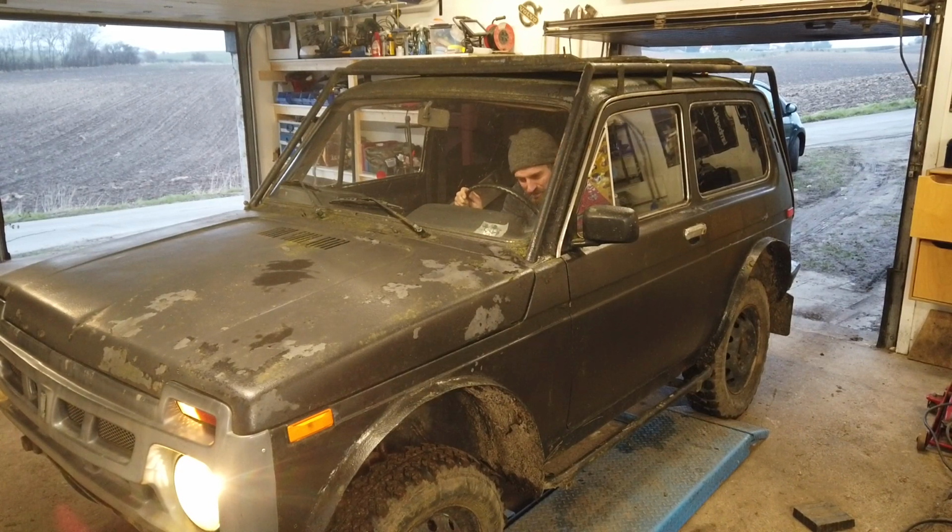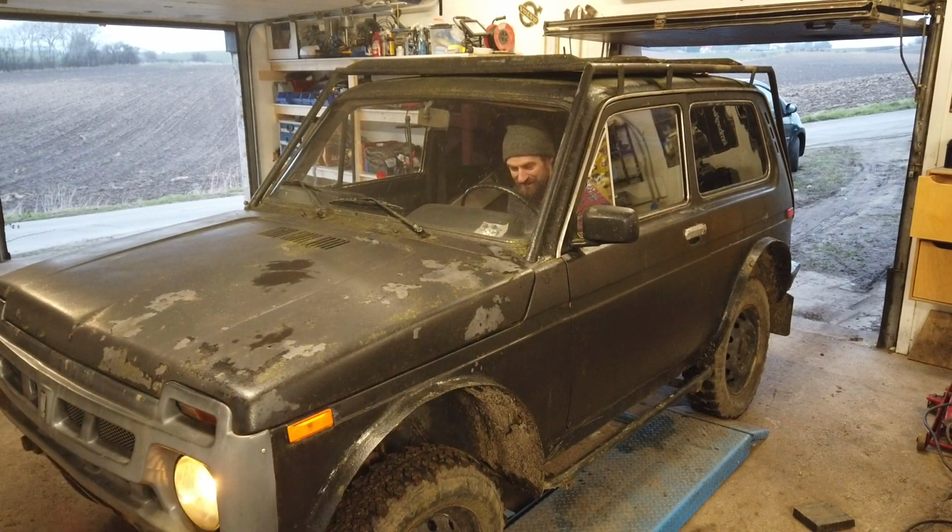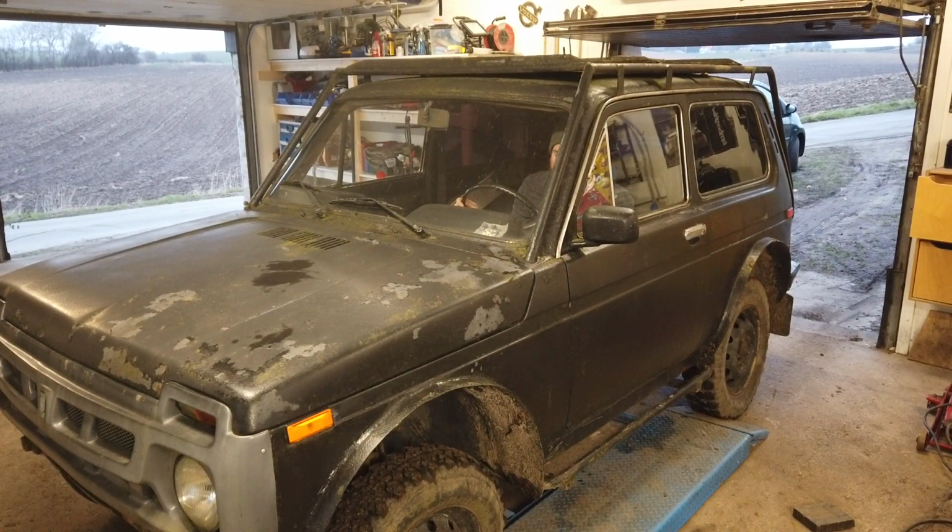The oil pressure reads 0, but I am suspecting that it's not really working. I hope. Well, maybe I should check the oil pressure on this because it is reading 0. I don't think it's 0, but we need to check that out. Because also, remember from the previous video, there was a light indicating 0 oil pressure that went out when I cranked the engine, so oil pressure at least raised to the threshold of the warning lamp, but that lamp is no longer present. So even though I know it could crank pressure, I'm not sure, but it's all good.